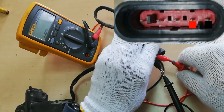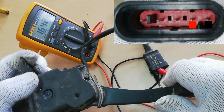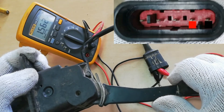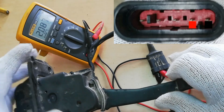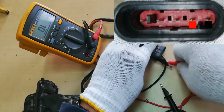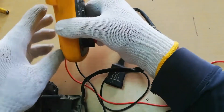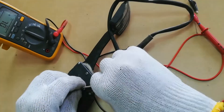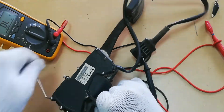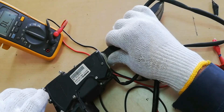Check the resistance between pin number 4 and pin number 5, as shown on the screen. From the neutral position, the resistance is 2065 ohms. When pressing the Accelerator pedal, the resistance decreases to 1575 ohms — the same as the good Accelerator pedal. The only difference is the resistance between pin number 1 and pin number 2. The defective Accelerator has resistance between pin 1 and pin 2 even in neutral, unlike the good Accelerator which starts at zero ohms in neutral and increases when the pedal is pressed.